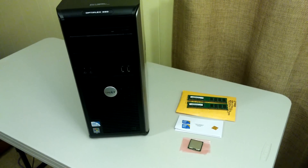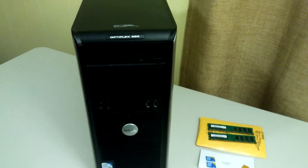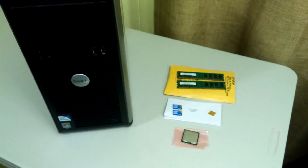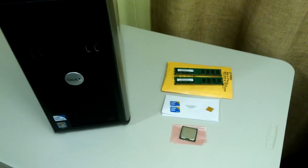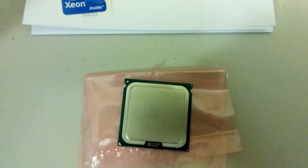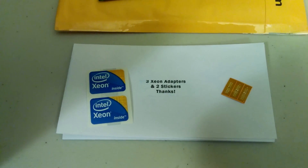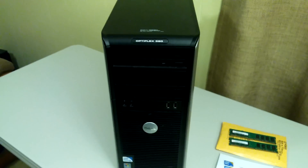In this video I'm going to be hopefully rejuvenating this old OptiPlex 360 computer with about $40 of eBay parts. We have 4 gigs of DDR2 memory, a Xeon E5450 CPU — it was about $23 — and then a sticker to convert it to the electrical pinouts used by Core 2 Duo machines such as this one.